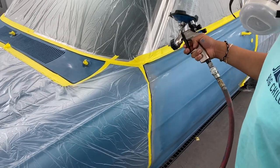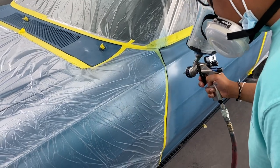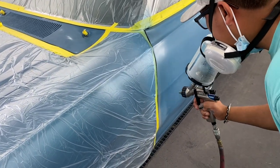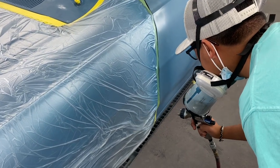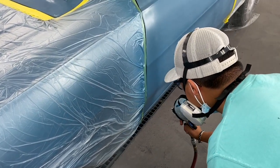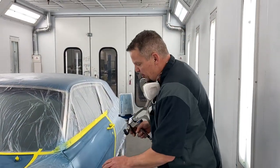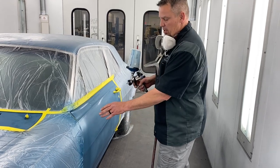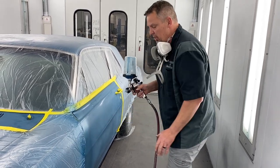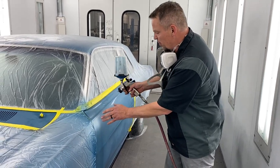Got a little bit on the door here. Once we get it covered in, then we'll worry about blending the color back. This color doesn't cover very well, so it's going to take a second. He's got two coats over top of where the repair area was, so he's got it the right color — almost. We're going to put another coat and blend it out this time.